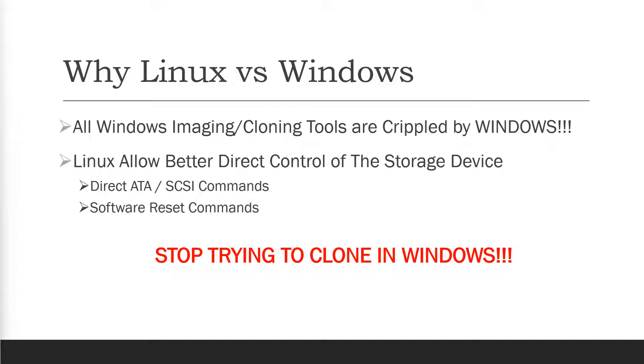Don't think that you can run Linux in a VM and that's going to resolve the problem — you need Linux natively running on your computer. If you don't feel like installing Linux, then the way to go is through a live USB, and that's what we're going to get into in this video. In the next video, we're going to go over how to actually issue the DD Rescue commands to clone a drive to another drive.